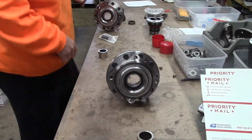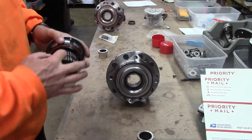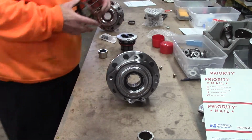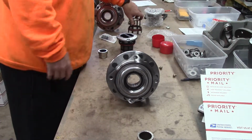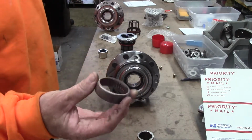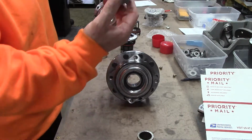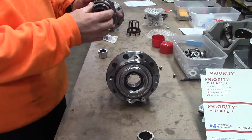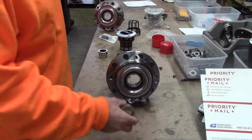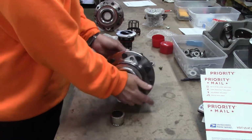And then you move on to the locker units. And right underneath here, in this cage, the needle bearing is replaceable. Standard HK 4516. So, you can replace the cage bearing, you can replace the rear bearing, you can replace the thrust bushing, and it's only up to you.